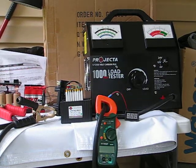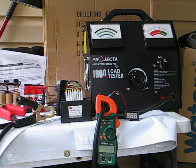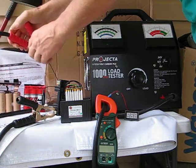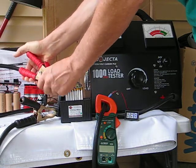This is Zero Lithium TV. We're going to test some batteries here today to see exactly what kind of cranking power they actually have. We'll be taking them down to 8 volts, which is minimum cranking voltage, and then we'll read the current output that each of these batteries is capable of.